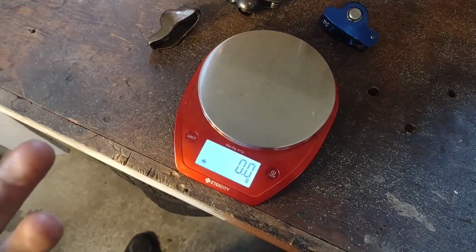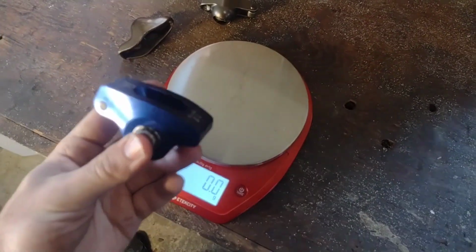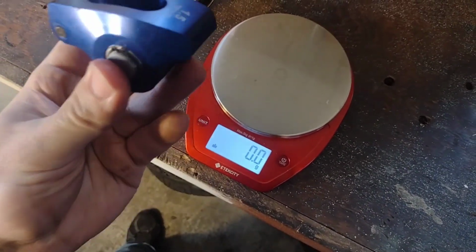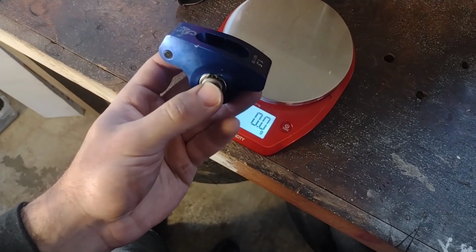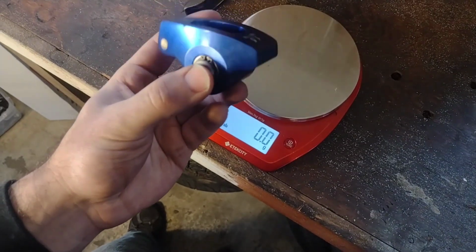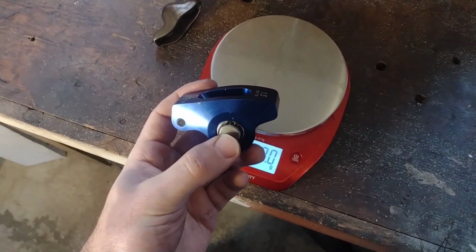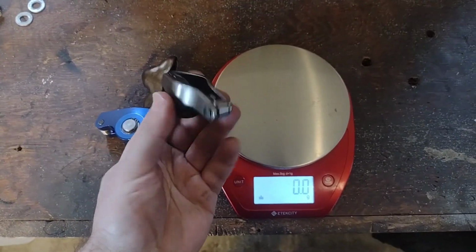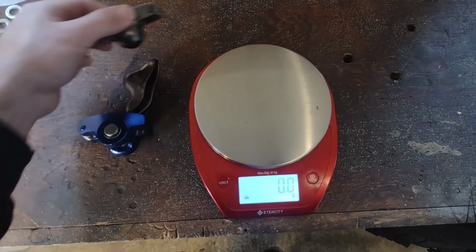So in addition to introducing this rule that we're allowed to run the full roller rocker arms, they're also introducing a valve spring rule. I believe it's a max of 130 pounds on the seat and 350 pounds open. That means you can't just run a bigger valve spring to control the heavier mass of this rocker arm. So there actually is going to be a bit of a trade-off as guys decide: do I want to take that risk of valve float? Do I want to potentially re-engineer what cam I run and essentially my entire valve train system? Or do I want to just stick with the devil that I know and replace these guys every so many races? That's something I'm going to have to think about, certainly as I put this motor together.